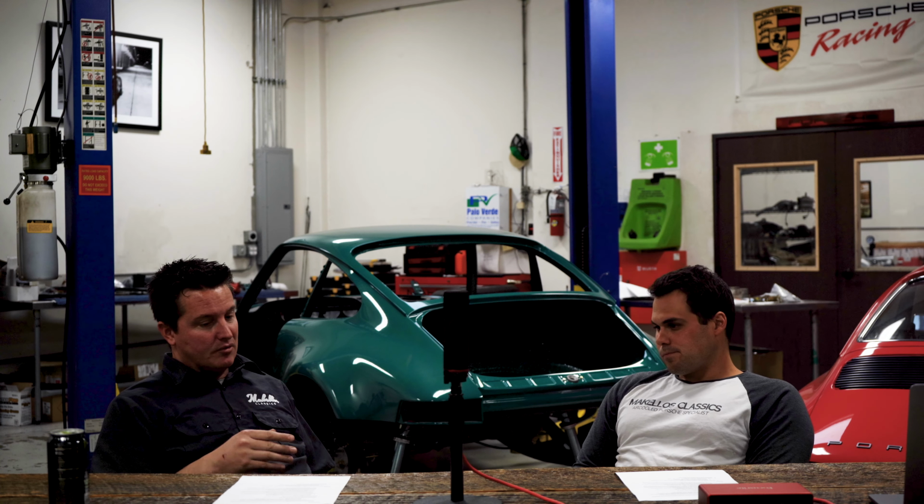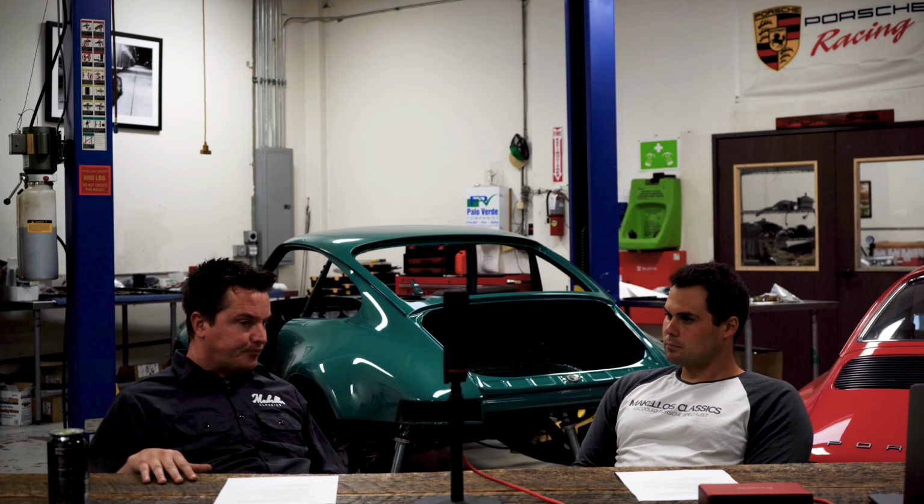Right, and you're picking brands or you're picking technologies. Again, the two camps are torsion-based and coilovers. With torsions, you're limited in the size of the torsions you're picking, limited to a small camp of what type of bushings you're using, and then what inserts and shocks. You go to coilovers and now you have to start playing with those bushings. You're not going to really use coilovers with stock rubber bushings. So there's a lot more to factor in.